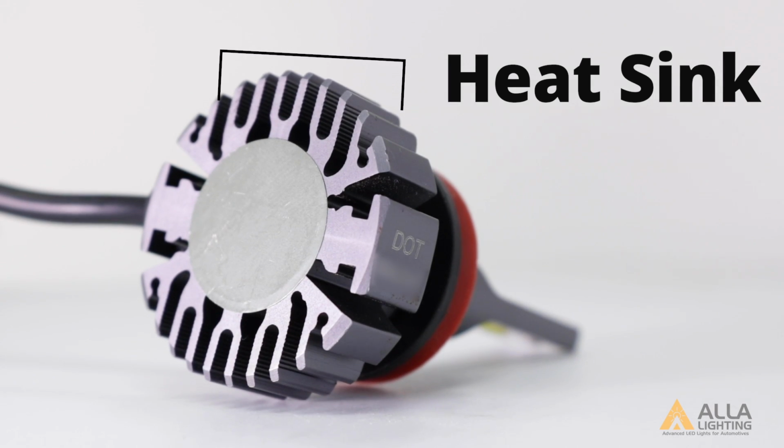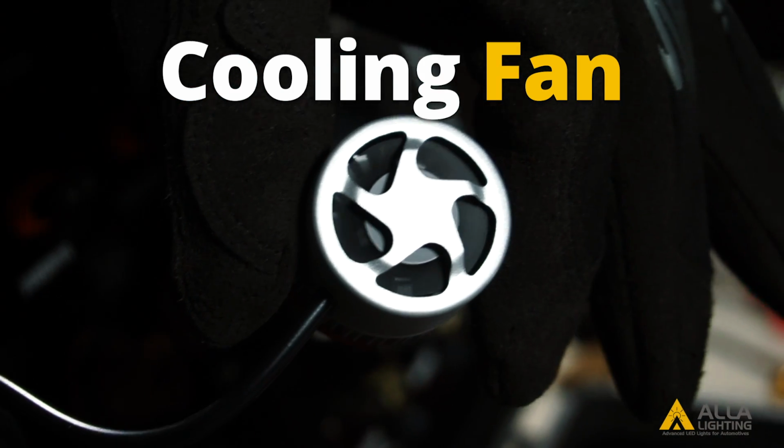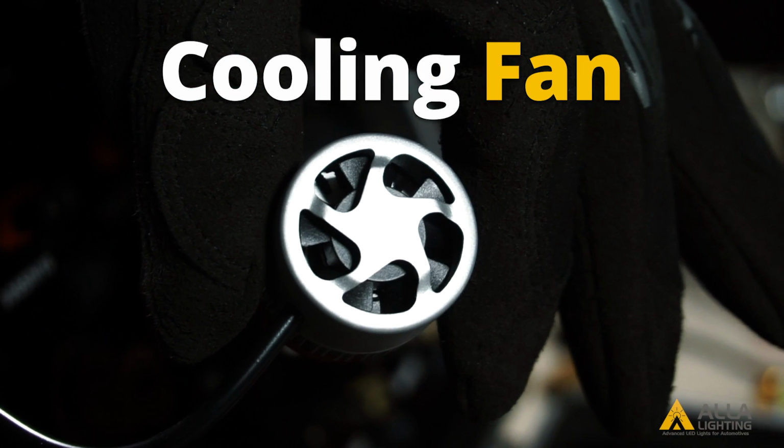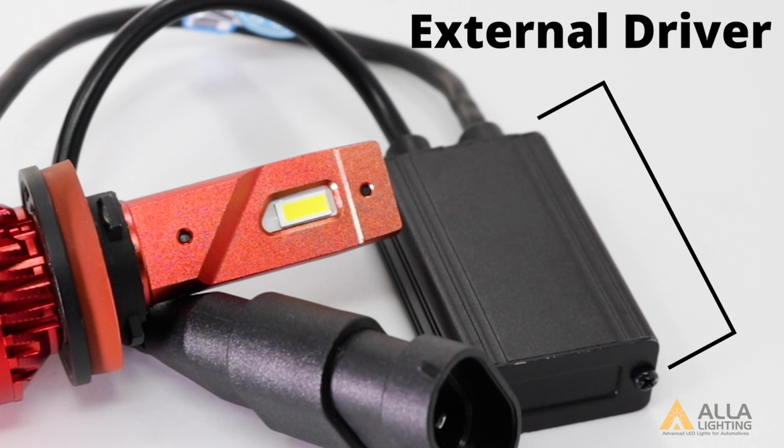LED bulbs can use heat sinks to create more surface area for the heat to dissipate. Some designs will use fans with a higher RPM to dissipate that heat. The fans create noise but help to dissipate the heat more efficiently. All LED bulbs need a driver to maintain operating temperature of the LEDs by reducing or increasing the power drawn. That driver also generates a large amount of heat.